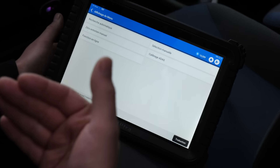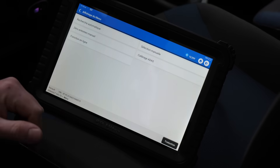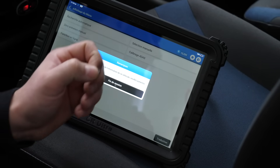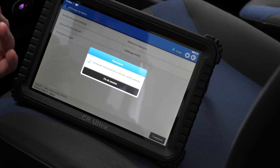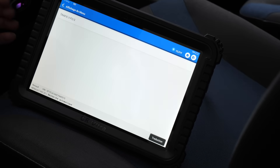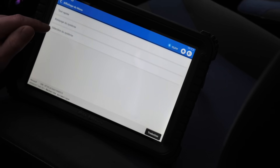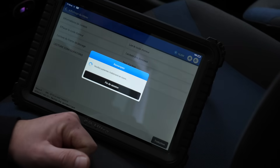So we move to the next step. It's going to involve using a more powerful product injected directly into the working zone. But before that, I'm going to show you how to detect a blocked FAP. Of course, I can't trigger a particle filter regeneration because the FAP is so clogged that the vehicle will refuse it. We need to clean the particle filter first. Today is a product test, and once we clean it, we will be able to trigger a regeneration. I'm going to connect the tool and you will see an error code linked to the particle filter.